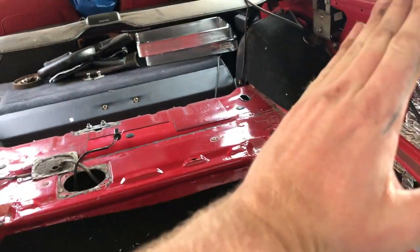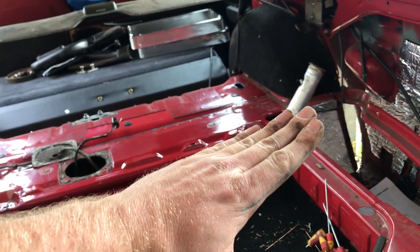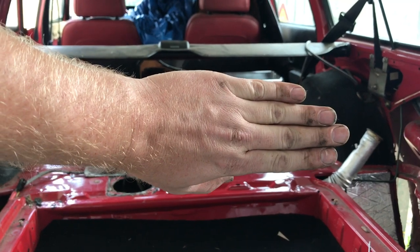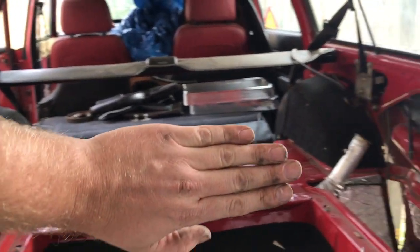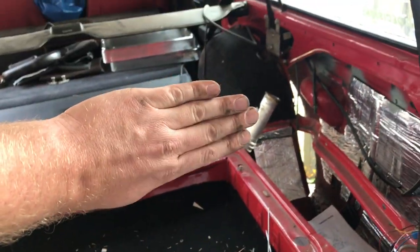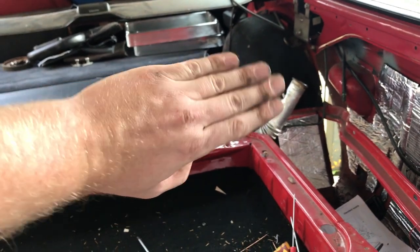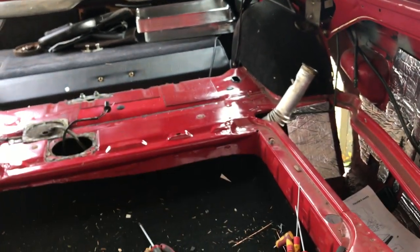What we're going to do is rotate the tank with the upside towards the back of the car. When the tank is flat, we tilt it like this and then move it towards the left rear side of the car. Then the filler neck is not pointing up but forward, and we can make this motion because there's lots of space underneath and in the back of the car - especially with no muffler or silencer in the back. Let's jiggle it out.